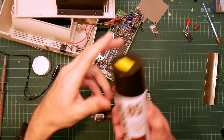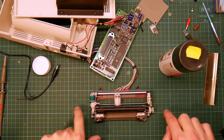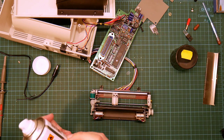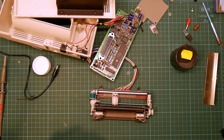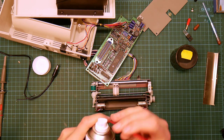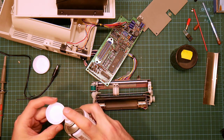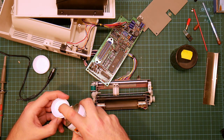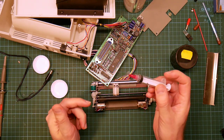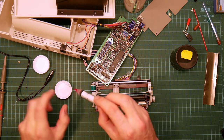I have two lubricants. We have contact flon — this is safe to use on nylon, which I'm going to use for most of the gears and the metal track that this thing moves on. I also have a light lubricating oil that I'm going to use for some of the bearings. I wasn't going to spray it directly onto the thing — I'm going to spray a little into this cup and then use this syringe. This is not a hypodermic syringe, it is an ink refilling syringe with a blunt tip. I'm going to suck some into the syringe.